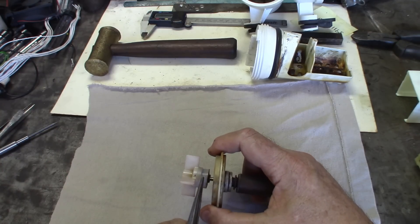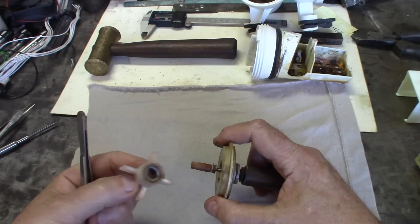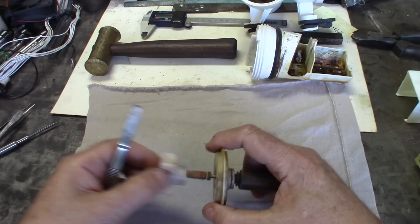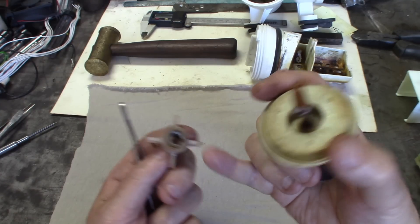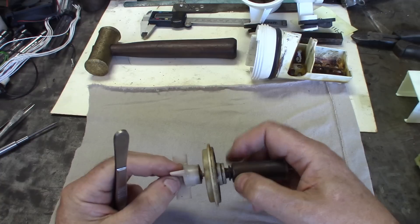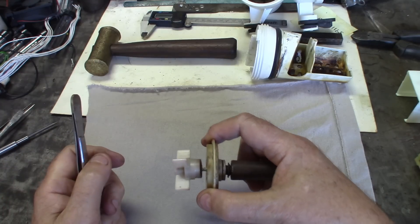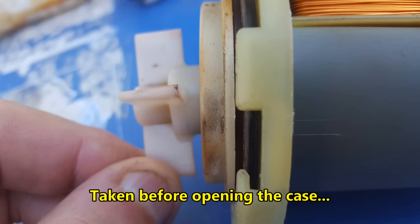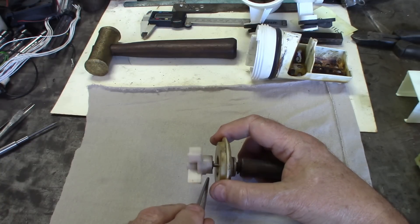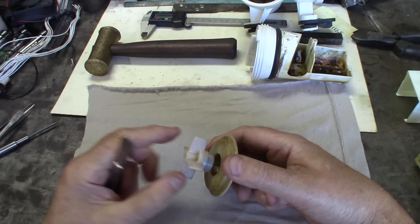This surface should be pretty even all the way around. This little impeller here stands on these parts, and there's a hollow inside — the inside is bigger than the actual shaft. So if a part gets through and hits hard enough, the impeller gets knocked crooked. See how crooked this impeller went — it was just being hit by some part going right through. The impeller was then rubbing on this stationary part here and wearing it out, going in all directions.